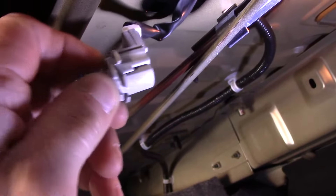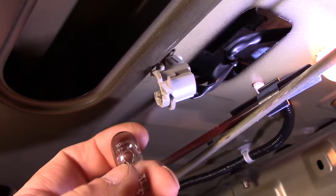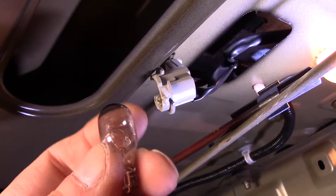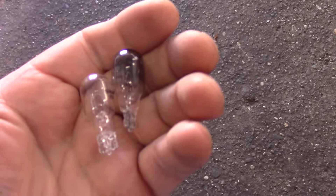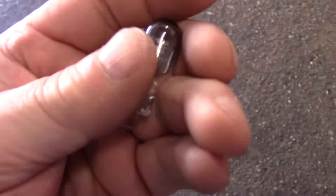And there is your burnt out light bulb. Let's grab our new bulb and we'll throw it back together. Let's see what number bulb we have here and grab the new one. Always make sure you put the correct bulb — this is a 921, so that's exactly what we're going to use, an exact replacement. Even though another bulb will fit, always make sure you use the correct one.